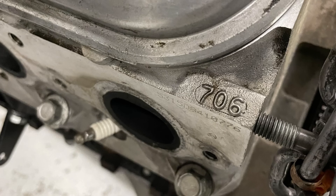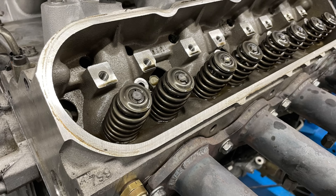What about cylinder heads? It's got those junky old 706 heads. What if we install 799 heads with a valve spring upgrade? There's a little Truck Norris cam deal on the 706 — did it need more valve spring under boost? This is a good test.